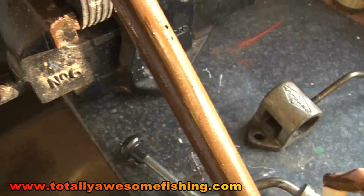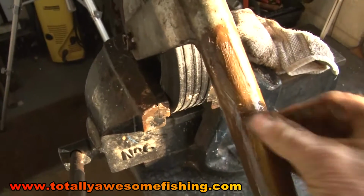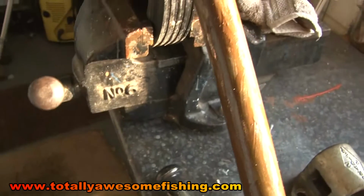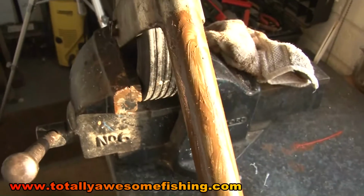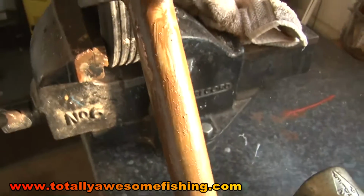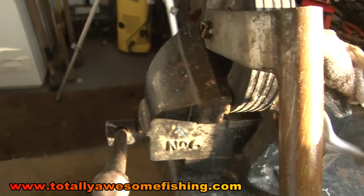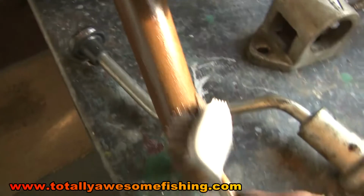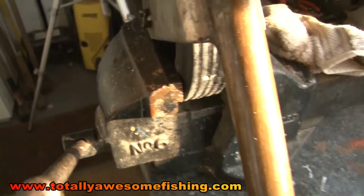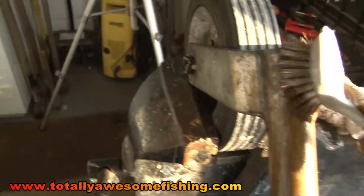Now I find with this gunk that's already up the shaft here, I would spray it with WD-40, soften it all up, work your way down, use a brush, fingers. You can always use a scrubber like this one, just to, yeah, that's better, just scrub it and loosen it all off. Then I can re-grease it, and I can also run up and down it, re-grease it and run up and down it with a little wire brush in a moment. And the same for the internal shaft. That's going to have a good soaking as well.